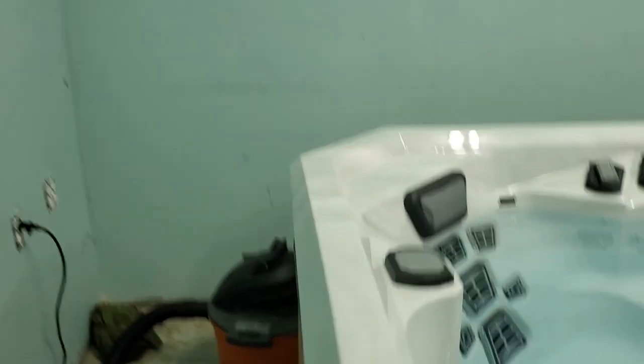Chris Wheatley here from Hot Tub University. We've got our Vector 21 up and running — the reason we got it up and running is we sold it. Right out of the gate we had a leak on it. We marked it last night with some tape just to see if it was going to lose water overnight. What we had this morning was water coming out the side. All around the edge of the tub was water. We started pulling foam out and look what we find — a manifold that's leaking. No clamps on the plumbing lines. There's no clamps on that manifold, and man, that's critical. If you're not clamping your joints, you're going to have leaks, simple as that. There's a whole manifold over there with not a single clamp on it that's leaking — brand new tub out of your factory.